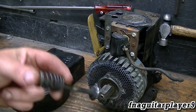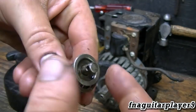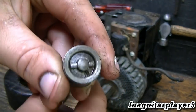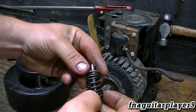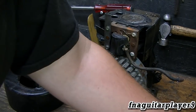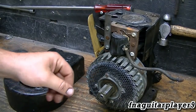I want to talk about the valves first. This has the old type of retainer clip — it's got a rod that goes through there and that's what holds your retainer clip on. When your spring comes off, it's actually a really simple design, and I think it's probably more reliable because there's no way for it to come out. Both valves are like that too, so it's gonna be real easy to put back together. I'll compress the spring and retainer clip together, then just slip that in. I don't know if the coil is good or not; if it's not I'll have to order a coil for it. It does have points and condenser, so hopefully that's all it might need.